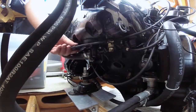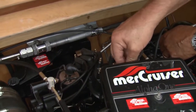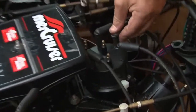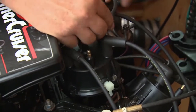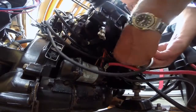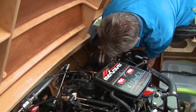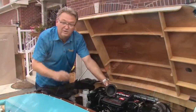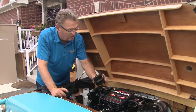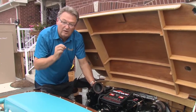To ensure you keep the firing order intact, change one wire at a time. After removing an old wire, select the matching length of wire from the set, plug it into the correct location on the new distributor cap, and connect it to the spark plug. You can see why it's important to follow scheduled maintenance — what we found here were a few fouled spark plugs. I'm going to tow down to my dealer and have the Mercury techs set up a timing light and make sure the ignition timing is right where it's supposed to be.